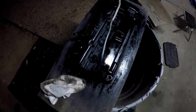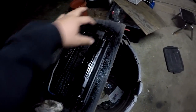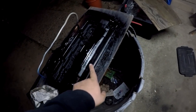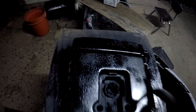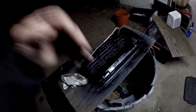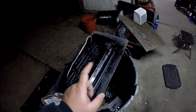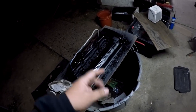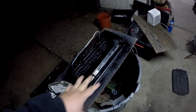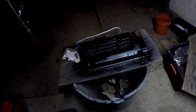Just applied the third coat heavily. I had this whole section all wrinkled out except for one spot that had a wrinkle but not as deep as the others. I'm gonna let this air dry overnight. Tomorrow I'll throw it in there again and let it bake for an hour plus. It's looking really good - crossing fingers that it wrinkles in all the areas, or at least the most visible part of the valve cover.